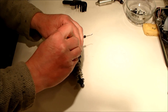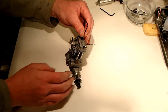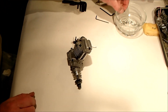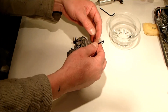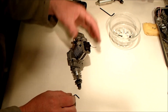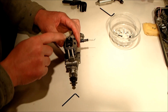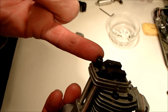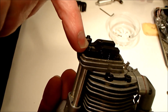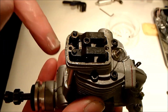On inspection I discovered a couple of issues. The first was that the inlet valve was stuck fully open — a bit of light tapping was able to unseize that. However, a more major issue was the fact that the adjuster on the rocker arms for the valve clearances had broken, or at least the nut had snapped off — or been snapped off by a previous owner. I actually found the nut inside the rocker housing.